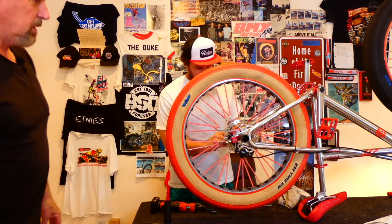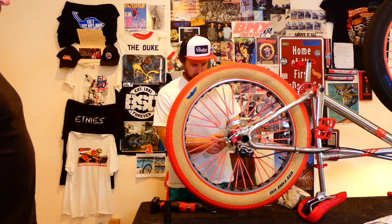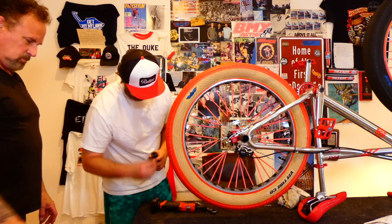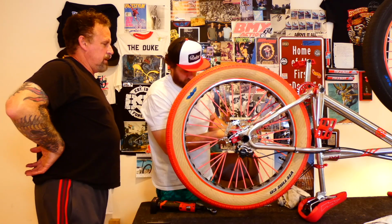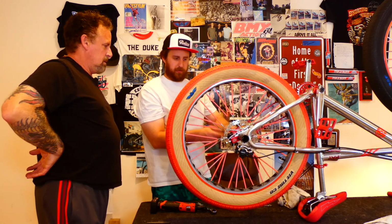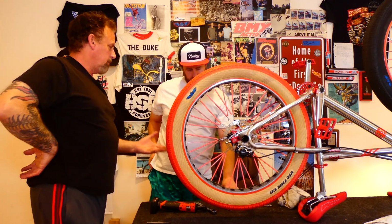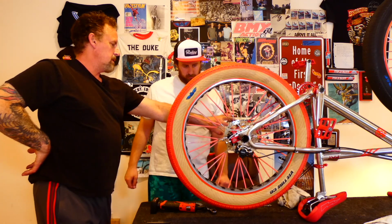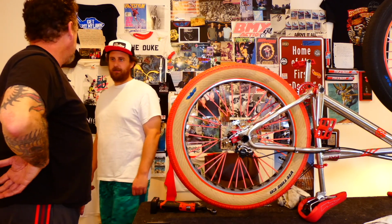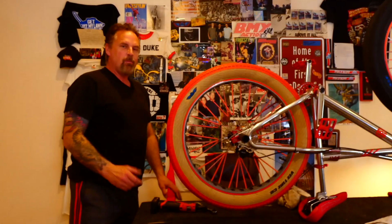Wow, that's a whole different looking bike, man. Yeah, right? So, I'll do this side. I wonder if we should show them the breakdown of that little ring in there. I know, but you take that out, that ring comes out if you're running a 14 millimeter axle. If you're running 3/8, then that spacer goes in. Oh, I see what you're saying. But we're not gonna go back through that, I take it. No. Well, I'm gonna tell them.